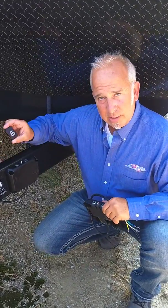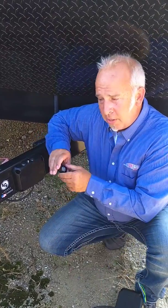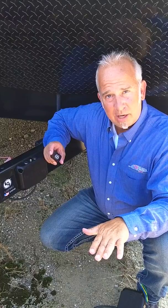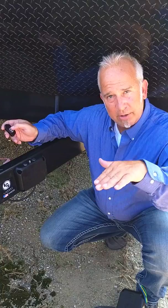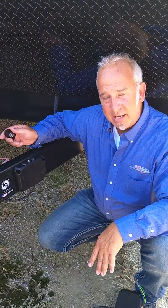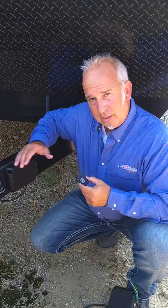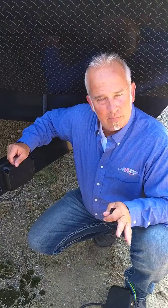The last thing is we have a little key fob, and it has two purposes. The first is, let's say you're driving and you want a little bit more aggressive braking. You're going to lightly apply the brakes on your tow vehicle while you're towing, and you can hold this button up and click it — it's going to increase braking. If you hold it down, it's going to decrease braking. This way you can tailor your preference. Some people like to have those brakes overpowered, and that can be done. Once the setting is established and you're comfortable with it, the Auto Brake will stay at that same setting continuously.